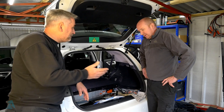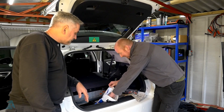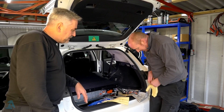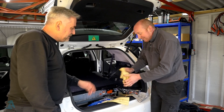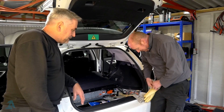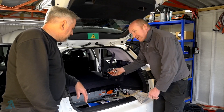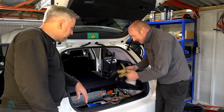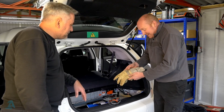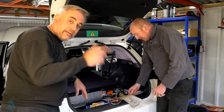Next thing is to get all our safety gear on — we want to disconnect the service plug. We've got to do a few checks on our gloves. We roll them up and check for any holes — if we squeeze them up and they hold pressure, there are no leaks. Even the smallest pinhole could be dangerous. We also wear safety goggles to protect our eyes, and an extra precaution is to wear a standard set of gloves over the top of the high voltage gloves, to protect them from splits or damage while working on the car. Laser Tools do these as well — I'll put a link in the description.